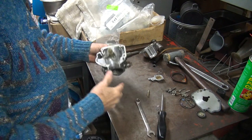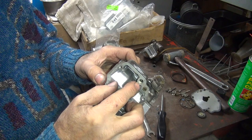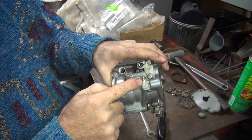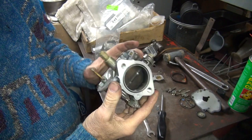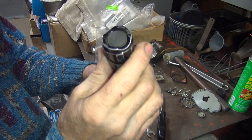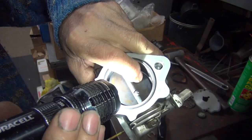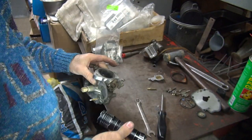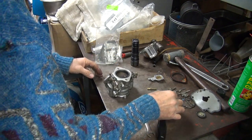We've got our low speed jet. We have no way of cleaning out our low speed jet circuit — the gas gets sucked up through this hole, goes up in the gallery up to here, up into this area, which is all blocked off, and it comes out to transfer slots over here. We really have no way of fixing these areas — disassembling, or dipping it, or some other deal. See the three holes are in there. I've got a butterfly there, so they all look fairly good, but we don't know how they're going to run until we start it up again.